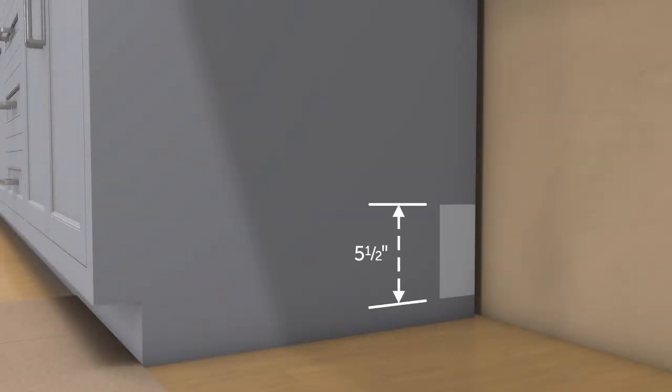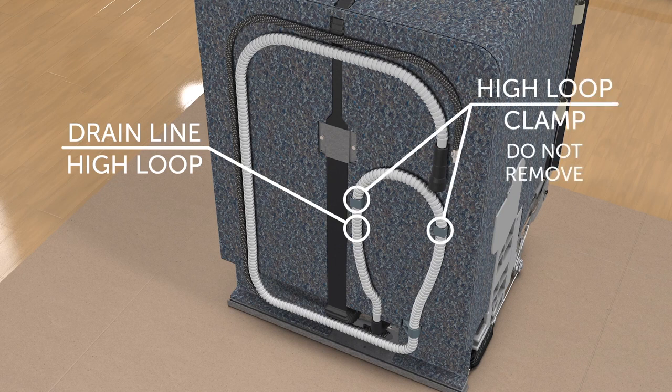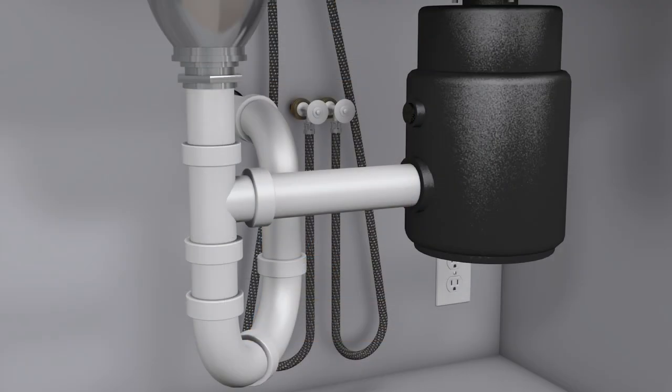Installation must comply with all applicable plumbing codes. The longest dimension of any opening into the adjacent cabinet must not be more than 1.5 inches, and the edges of the opening must be smooth and round. A drain line high loop is factory installed on the unit — do not remove the high loop clamp. If necessary, the drain tubing can be extended by a maximum of 5 feet. Locate the water supply and drain in an adjacent cabinet, and connect the water supply line to the hot water supply with an easily accessible shutoff valve between the supply and the unit.